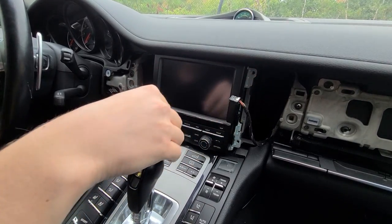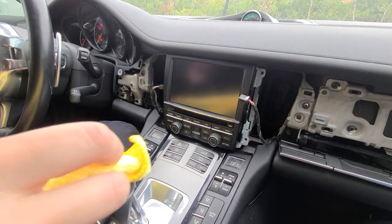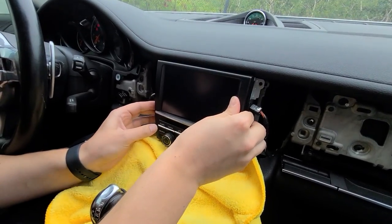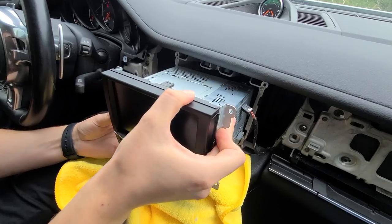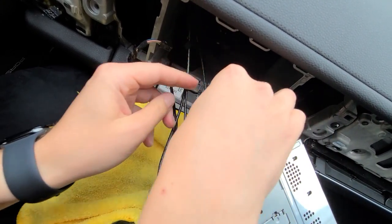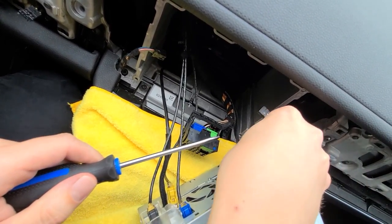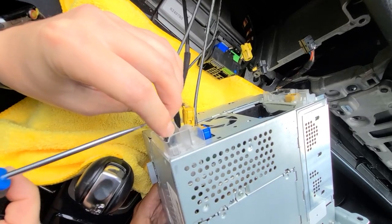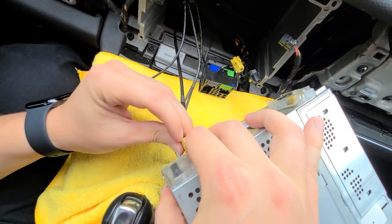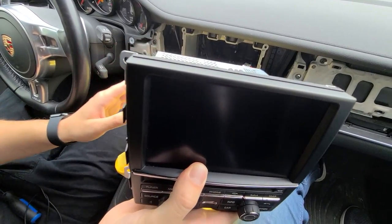With the four bolts removed, the radio can come out. Before we do that, there's not enough space, so you have to turn the ignition on and move the shifter. We also highly suggest using some sort of a rag so we don't scratch any of these parts. We're going to pull the radio out. At the back, first we're going to disconnect the main harness — there's a clip, which you press and remove. Then we're going to use a flathead screwdriver: press on the clip and use the screwdriver as leverage to remove the clips. Now we're going to remove the radio and show you the procedure on the side of it.